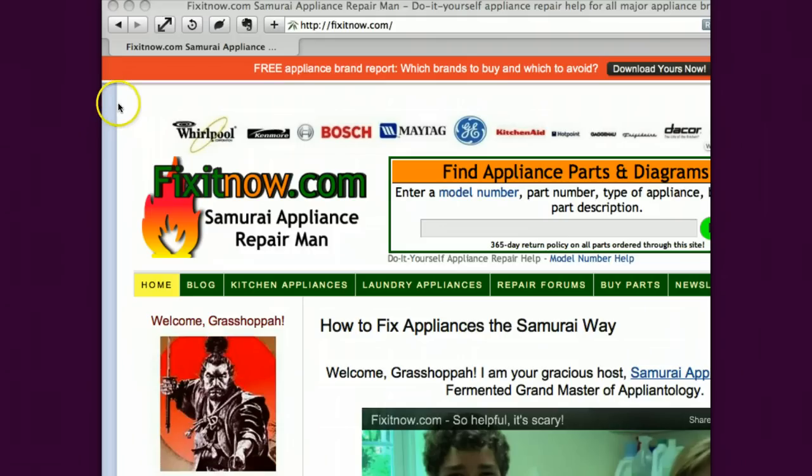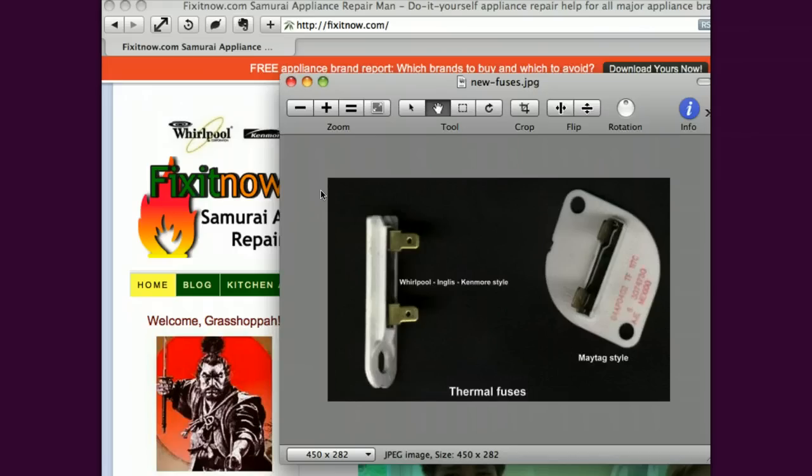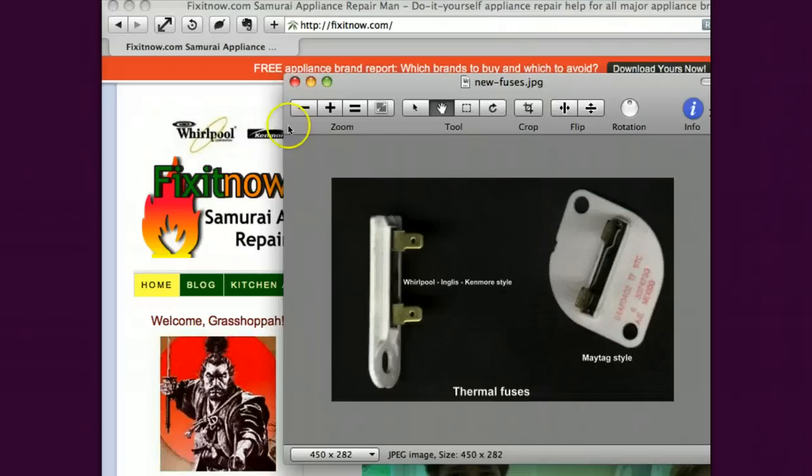A less common cause for electric dryers to overheat — and this only happens on some dryers and I've only seen this sometimes — is if the dryer vent gets plugged. Now typically what will happen in this case is one of the thermal fuses will open on the dryer and it will kill power to the whole dryer. These particular ones are Whirlpool/Maytag styles, but I've seen it most commonly on the Magic Chef style. The main take-home point is that this is a less common, more rare condition. Reason being that if the vent does get plugged, it will overheat briefly, and then one of these thermal fuses in the dryer — and they all have them — will open up and kill power to the heating element. In fact, if the thermal fuse opens, it will kill power to the whole dryer.